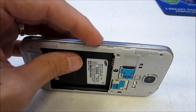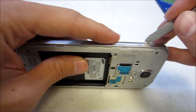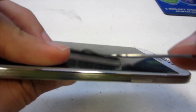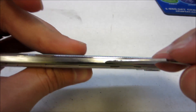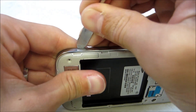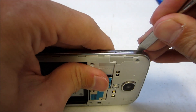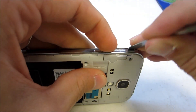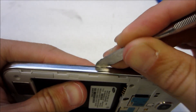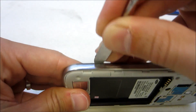The best thing to do is to get some type of pry tool, something that you can try to not damage it too bad, and go ahead and slide in between the first gap after the screen. You will see it right here — you will see a little gap. Anywhere that you can get some leverage on it. It can be difficult to get it started, and then just push your pry tool along once you get it in. You should be able to snap the clips.